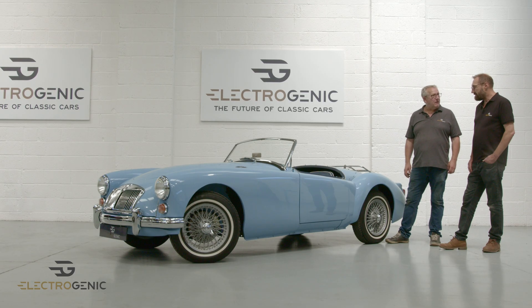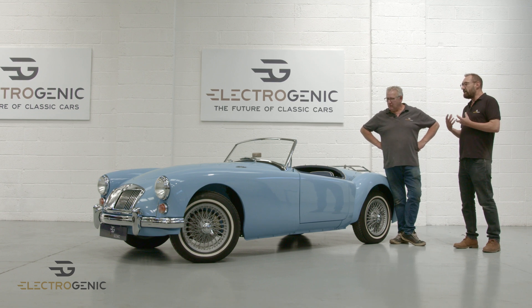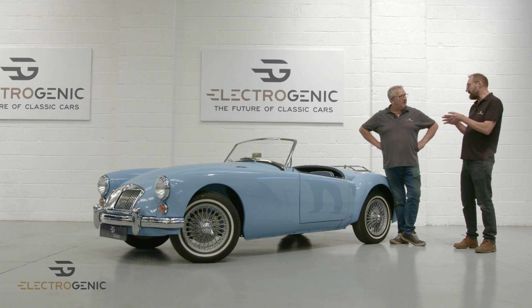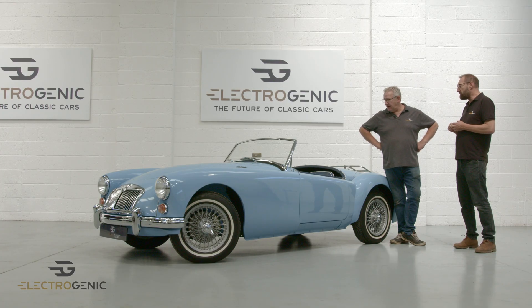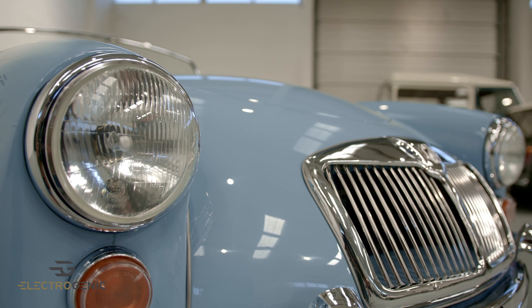Obviously you can tell me about the gearbox. So the customer for this one really wanted the classic English driving feel, so active driving with a gearbox. The original gearbox on these is not so good unfortunately, so what we've done is we've actually substituted a Ford Type 9 gearbox. It's a beautiful box, very smooth and quiet, actually very suited to the job and fits in perfectly. And then lightweight flywheel, adapter plate, Hyper 9. It's a nice light car, very suited to Hyper 9 — low voltage system and away we go.